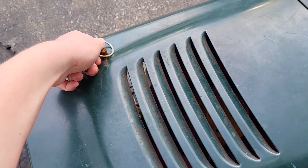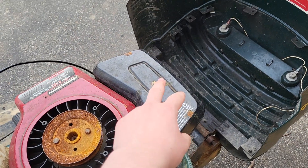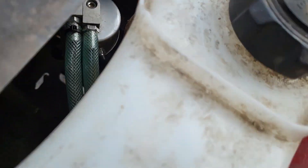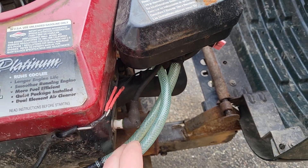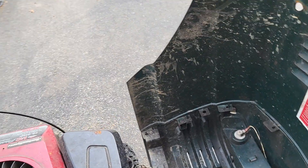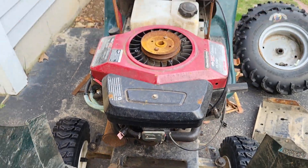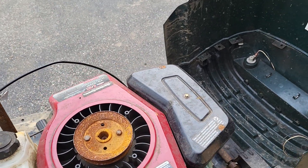The engine — once, after I rolled it over, I took it to my cousin's house. Ever since then the carb hasn't been running right because oil got pumped into it, so I made a fix to that. I added a catch can, which is behind the gas tank up and out of the way. I used fuel lines and zip ties, and only used portions of the original line to connect it. That helped, but the carb is still running like crap, so I'm going to get a new carburetor. Even though the 3-bolt fuel pump carburetors for the Oppies are better than the 4-bolt, I've been having no luck finding a brand new 3-bolt, so I'm just going to buy a 4-bolt and run it for now.